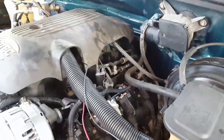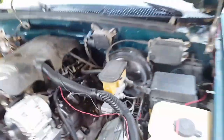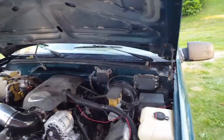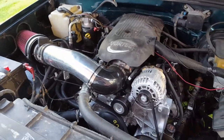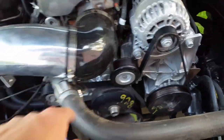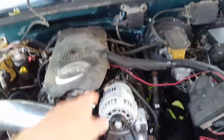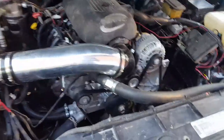I've got the Dirty Dingo mounts in there with the slider mounts — they save a lot of time. For the fuel lines I used compression fittings and meshed into my stock ones; works fine. Did a high-flow 255 fuel pump from highflowfuels.com. The intake is just a cheap eBay one. I think this is the original 4.3 upper radiator hose, and for the steam port I just ran a little line right there — it's not going to the throttle body.